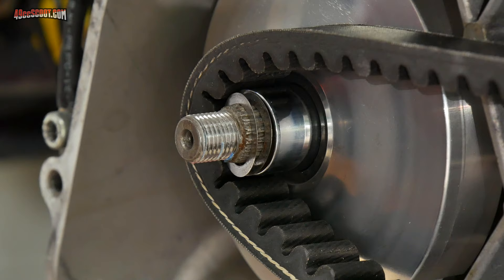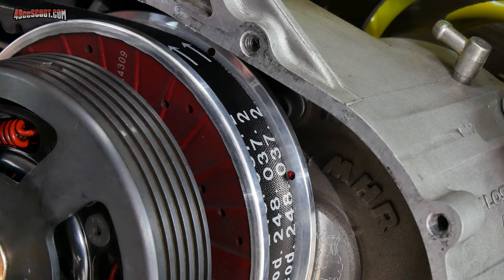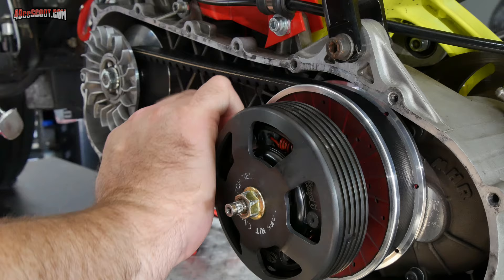The Polini belt looked promising, so I started by testing it alone to find out if the belt alone was a good upgrade or if it should only be used with the variator kit. I installed the Polini belt with 0.4mm of shims on the drive boss, just as I'd been using with the Molossi belt. Being a half millimeter wider, I expected to need more shimming, but there's limited room for spacing while maintaining spline engagement, so I tried it this way first. In this configuration, the Polini belt sat in a very similar position to the Molossi belt in the rear pulley — but it's actually a worse low gear ratio, because it's sitting higher in the front drive pulley due to its width.